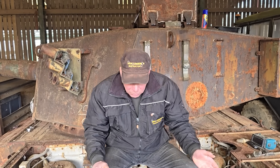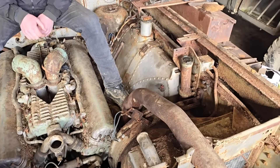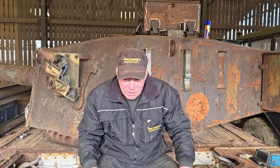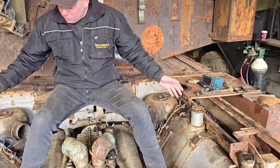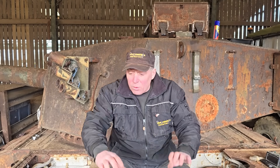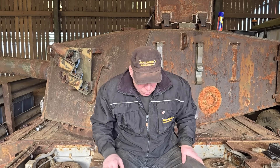Most of the pipework underneath has been removed. The fan belts have been removed. We've got a little bit more work to do on the front of the engine to get some bolts off under there. We think one more day of work and then we should be pretty well close to do a pack lift, if everything goes as planned — which obviously it never does. We've still got to get these exhaust pipes off and they're absolutely solid, so I expect there's a couple of hours of just messing around there. We did find that the fuel tanks — one either side — both got fuel in still, so that's a good sign; it means the tanks are still sound. Oil in all the tanks where there's supposed to be oil. And the water was drained, so it means there's unlikely to be any cracks in the block, because they had actually drained all the water out of them. Touch wood, that'll all be good.